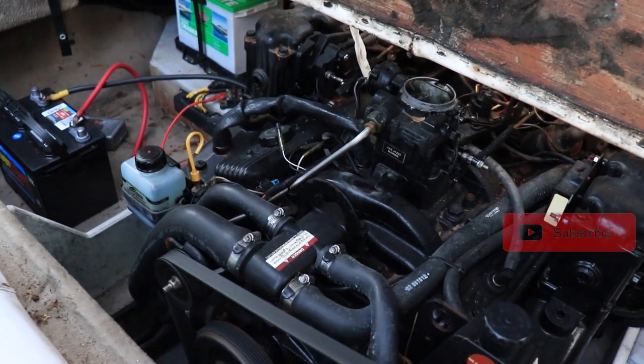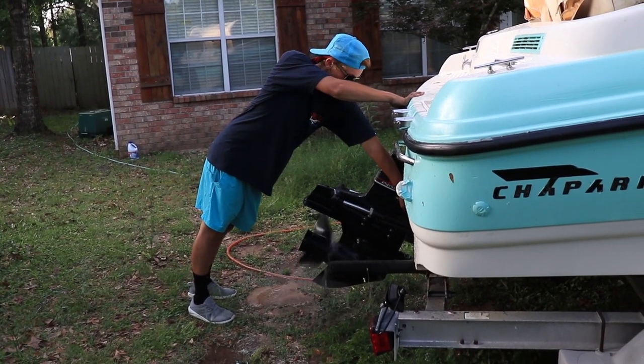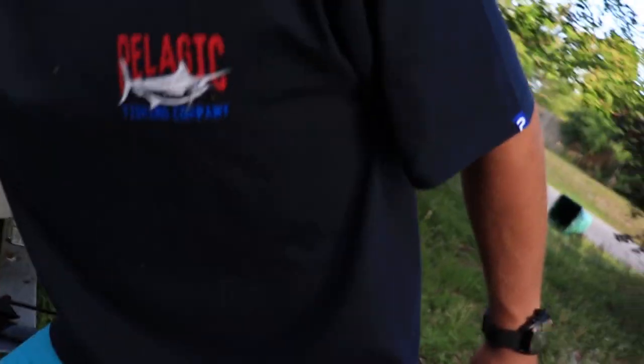What is that noise? Let's go to the back of the boat and check it out. Judging by the sound from the back of the boat, I'm fairly confident it is the U-joint. Let's see what we can hear with the microphone — let's put it right up to here. After you guys heard that, I hope you're thinking the same thing I am: it's probably the U-joints, which means we got to rip that outdrive off.